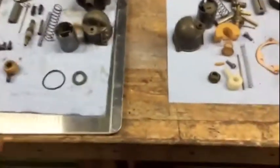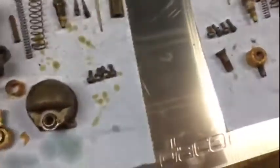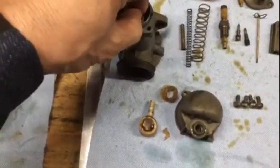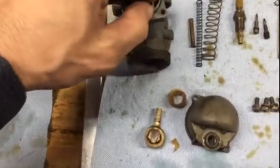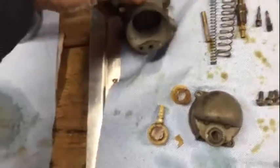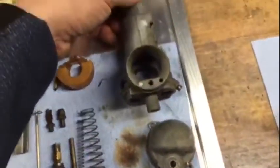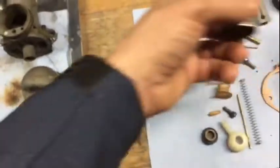I've got some semblance of order here - that's why I've been putting this off, it's been two years trying to get them all sorted out, which parts belong to which carb. I bought this one for a reason - I remember I broke something taking it apart. These carburetors on the bike were full of water and they were seized - the slides were both seized in there. I soaked them with diesel fuel and penetrating oil and just slowly wiggled them up and down to get them out, then had to take some emery cloth to clean them up and WD-40 them. This one works pretty good, you can see it sliding in and out, but this other one is still too stiff and sticking - I've got to clean it up more or use the slide off this carburetor to go into this one.